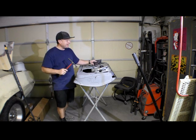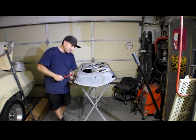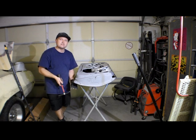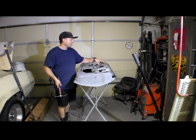After the lead shot bag, and the reason I use the lead shot bag is because when you hit directly hammer on dolly, that dolly has a tendency to want to deflect down, and then you naturally bring it back up to the surface, causing damage to the outer skin. So the lead shot bag reduces that.